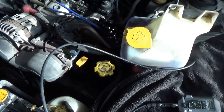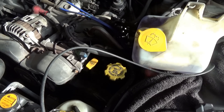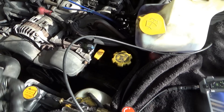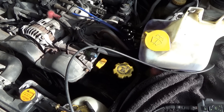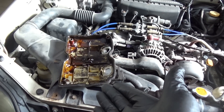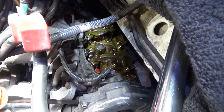On the single overhead cam engines, all we need to do is pop off the valve cover, and the head bolts are pretty easily accessible. I want to talk to the customer, see if they want to do this. Obviously, I can't guarantee the original head gasket job from eight years ago — no shop's going to honor that — and she's got her money's worth out of it. Considering it's a junkyard engine, I think we'll just try re-torquing the head bolts. It only took five minutes to get the valve cover off — no seized bolts or anything, and all the head bolts are easy to access: one, two, three, four, five, six.